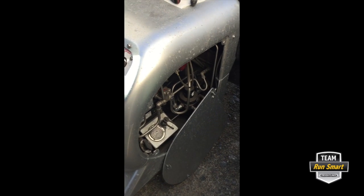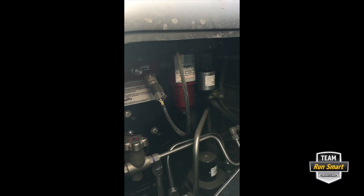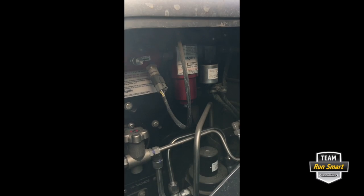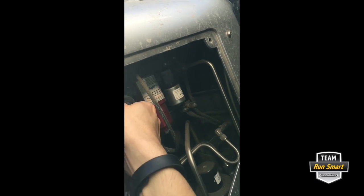We want to make sure there's no moisture in the high pressure filter. I've turned the camera angle around here so we can get a better view. Basically, what we're doing is making sure that the fuel systems where we're fueling are not getting any oil or moisture into the system at the inlet where it comes in. This is your high pressure filter and then your bleed valve. With the system all drained, we're going to go ahead and bleed this valve to make sure we are free of all CNG.